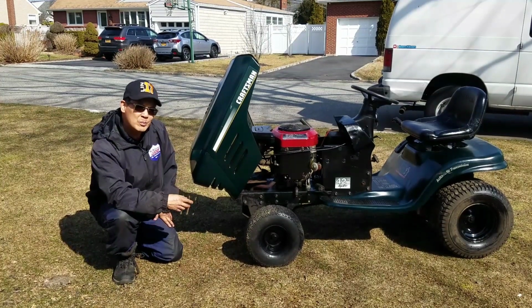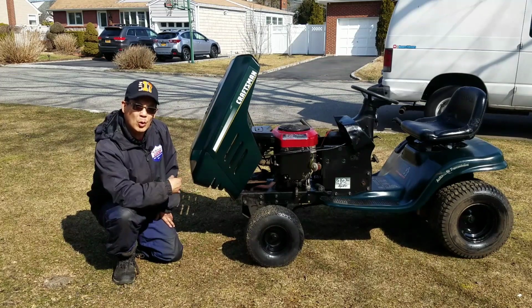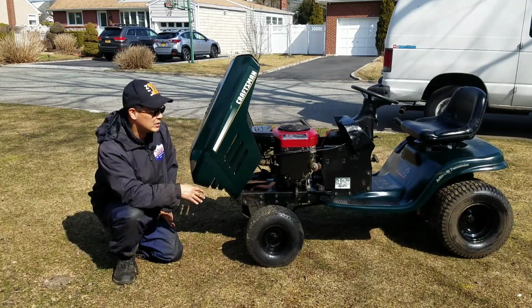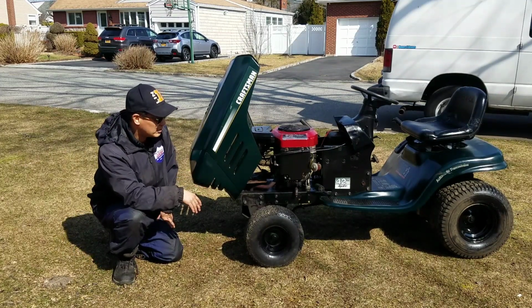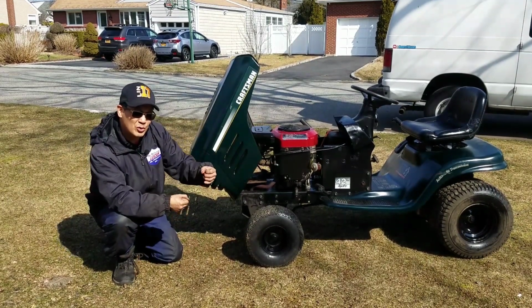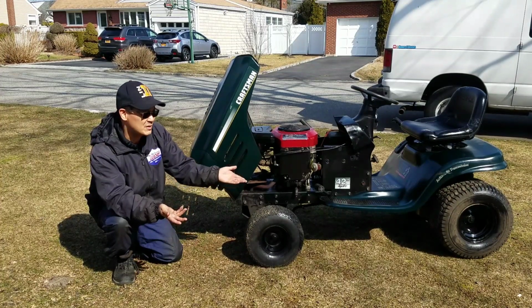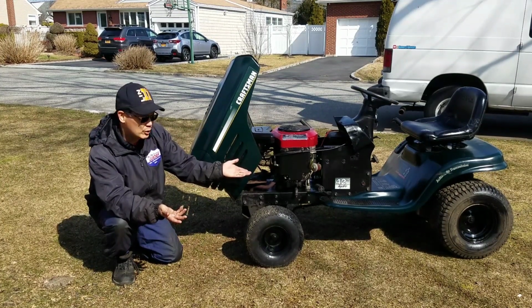We painted the rims. I flipped it on its side, cleared out all the buildup of old oil all around, cleaned up the regular stuff here, actually tightened up the head bolts over there. You could turn it a quarter turn, and I thought maybe that's where the leak was coming from. Surprised the engine even runs if it leaks oil out of the heads, you know what I mean?